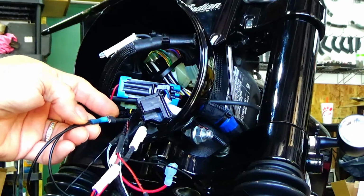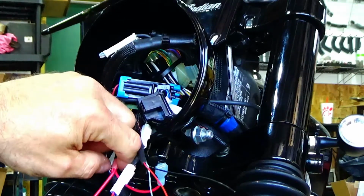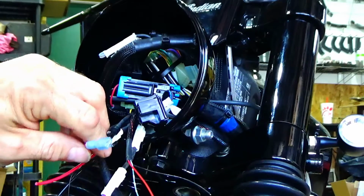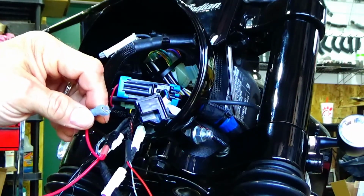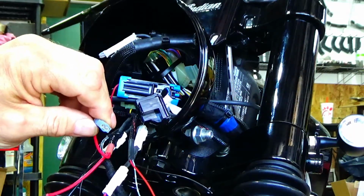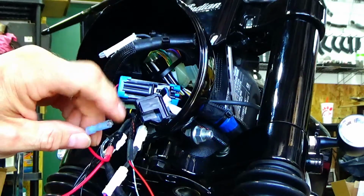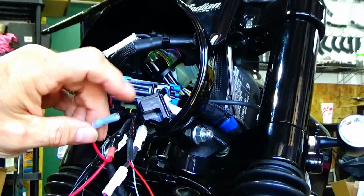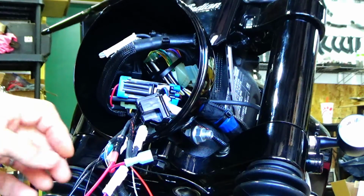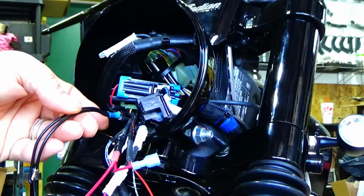Well, inside the Scout 60 headlight, there is a constant ground and there is a constant 12 volts. So I have this little pigtail coming off. Actually, there's 3 wires, 3 12 volts, one for each turn signal, and then one for the Indian running light and the headlight. And that Indian headlight will just plug right into there. The one single wire coming off. Now this is the Indian LED headlight, not the halogen, okay? Just want to make that clear. And then off the grounds, you have 2 wires, one of them going to each ground of the turn signal.